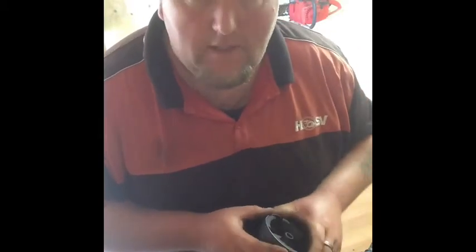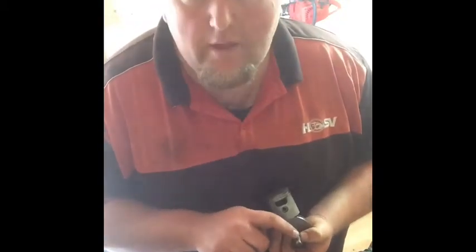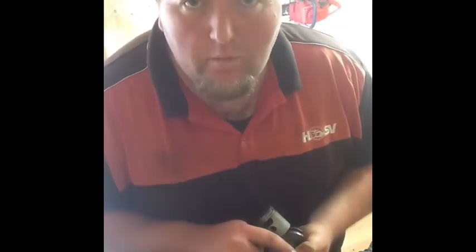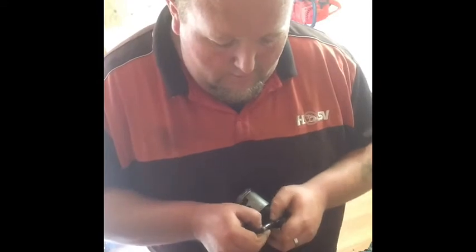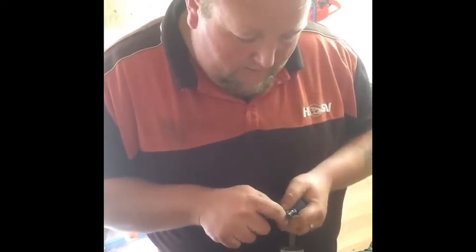Whoa, that's sick, because I can literally chip all that glue out. And I can fill that with weld and grind it back. I've got a gasless MIG, so I'll have it set low. So I can, well, that glue just comes straight off.